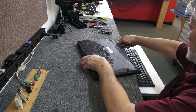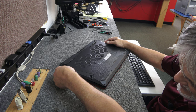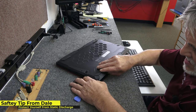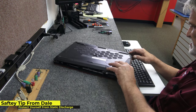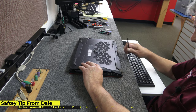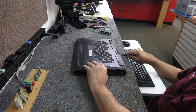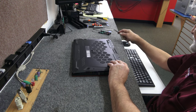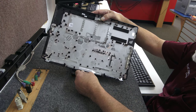These are usually not too bad, but along the back can be stubborn. Don't be poking any screwdrivers in there. Always make sure you protect yourself from static electricity before you get inside your laptop — wear an ESD wristband or a mat, or both. I'm all protected here, so I don't need to worry about it. We got it started but the back is being a little stubborn, so I'm going to get my other little spudger and work it very gently along this back seam. Just don't go poking in there a long ways with your tools. There's the bottom cover off — not much to see there.